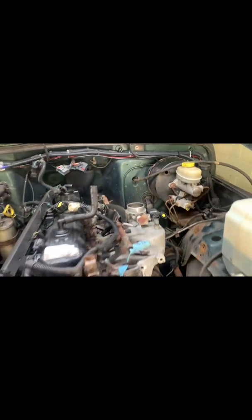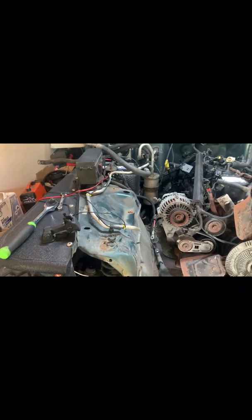I've come down to this point — got all the wiring harness off, power steering pump off, all the stuff back here, fuel lines. Getting the starter off, got most of the wiring off that I can see. All I have left is the upper bell housing bolts — got the lower one off — and then the motor mounts. Then we'll get the cherry picker back in here and lift it up. From what I read online, the easiest way to get those top ones is to take the motor mounts off, lower the engine down, get to them, and then pull it out. Right now I don't really see a way of getting back there to do it — I can't fit my hand back in there.